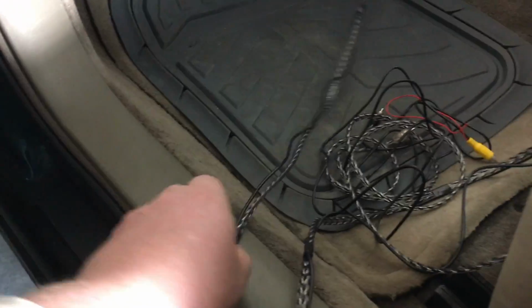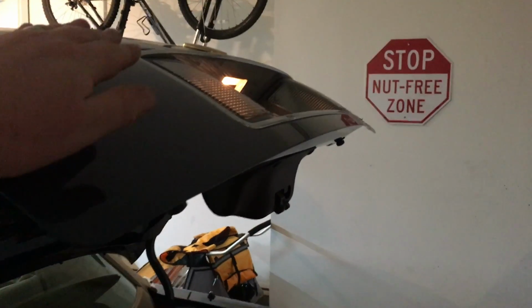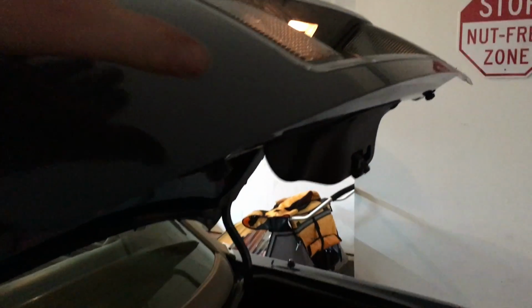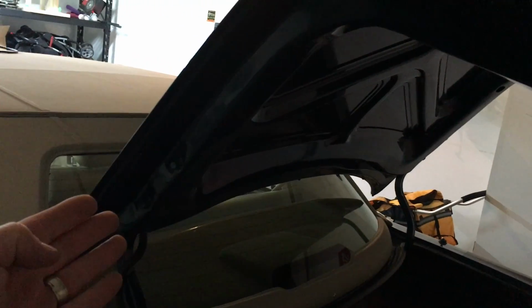But essentially, we're going to work our backup camera wire and just our generic pair of RCAs along the kick panel and work our way back to the rear of the vehicle. Now this vehicle, since it's the license plate camera we're installing, the license plate is up here up top. So as you notice, we're going to have to go through some split loom up to the trunk hatch, the back of the trunk lid, and run our wiring up there. But at least for now, that's a good start, and we're going to get going.